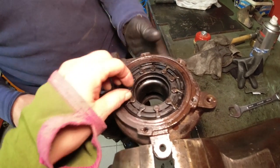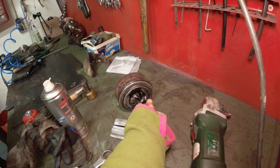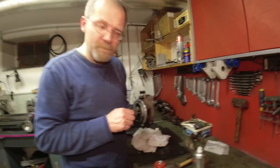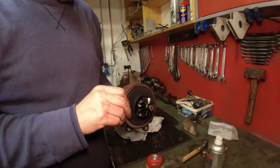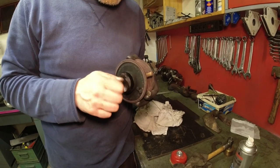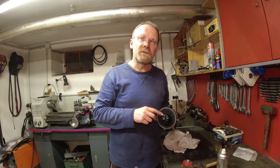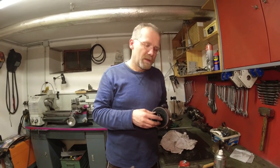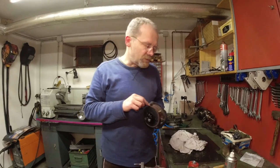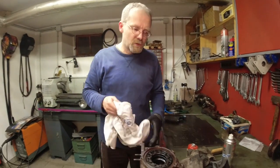And that is a chunk that came out of that thingy. This is the old turbocharger, which doesn't have any apparent damage to it. Let me explain why I replaced this. When you have a turbocharger, it's supposed to have a little bit of play. This one actually does have play now, but when we took the engine apart, this thing was locked up — absolutely solid, you could only turn it slightly. I soaked it in oil and brake cleaner and it freed up, but the contaminated oil with all the metal chips caused it to seize. I assume the bearings are worn out. So we found a new turbocharger for only 130 euros — that's called a turbocharger cartridge.